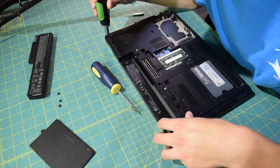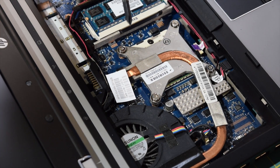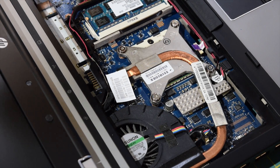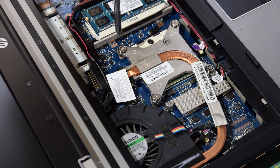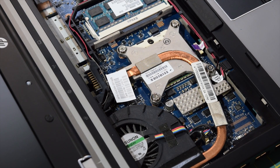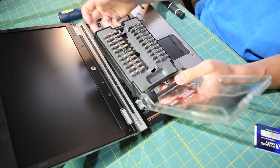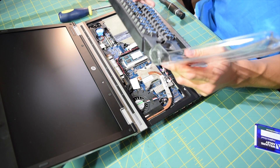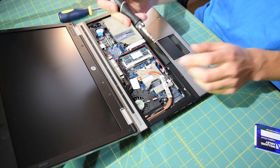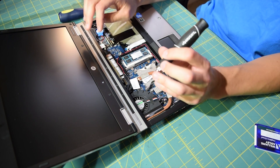So I've run into my first major snag. This laptop is actually very easy to take apart — all you have to do is remove a couple screws and you pretty much have access to everything. But I don't have a Torx bit that will fit these screws; they're all too big. So I had to make a trip to Home Depot to buy a set of smaller Torx bits. I'll put a link to the service guide in the description if you're trying to take one apart yourself. I just got back and found the bit I needed, but of course you can't just buy one bit — you have to buy a whole set, so it cost me about 10 bucks. Anyway, got the bit now and I can continue tearing this thing down.